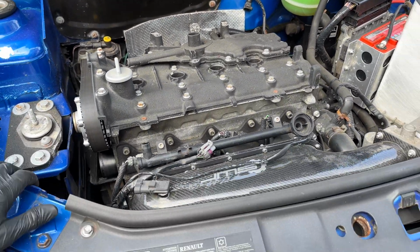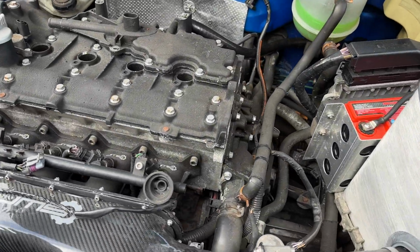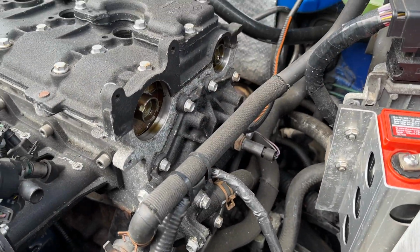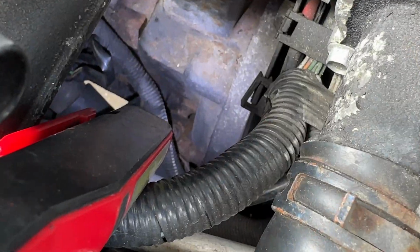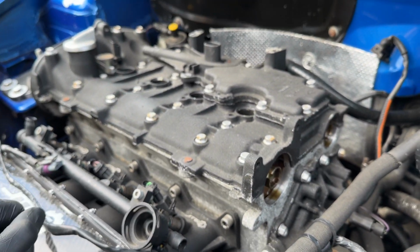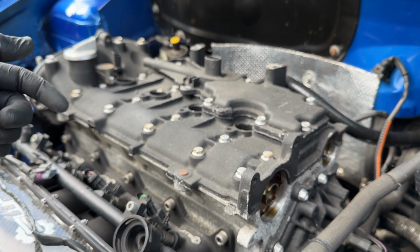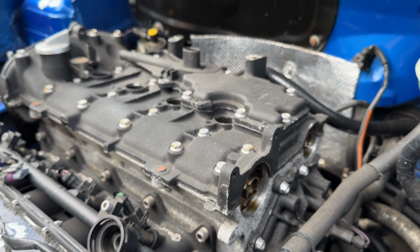But now with the engine resting on the subframe, you see the trolley jacks out, we can now start getting the locking pins in. Now essentially we've got the horseshoe bar, which is going to go in here. We've got a crank pin, I don't know whether you're going to be able to see it, it's going to go in down there. I'll get the torch in a minute. It's an e-Torx bit, and then as the engine's lowered now, we can put a socket on the end of the crankshaft and just rotate the engine until it lines up to get the tools in.